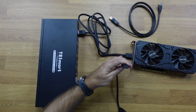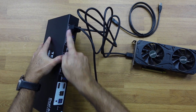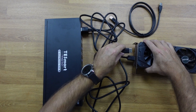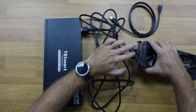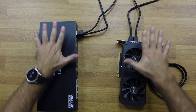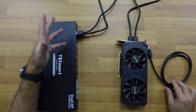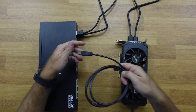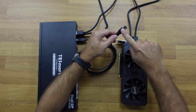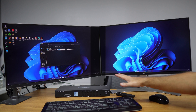The second connection is just as easy — we connect another DisplayPort cable to input B on the KVM and the other end to the same computer. So we have A and B connected to exactly the same computer. The final step is to connect the USB Type-B port on the KVM and then the USB Type-A end to our computer. That finishes the installation of computer number one.